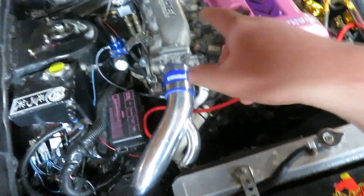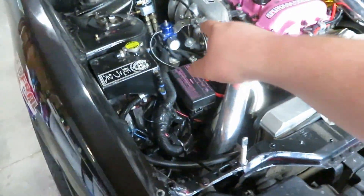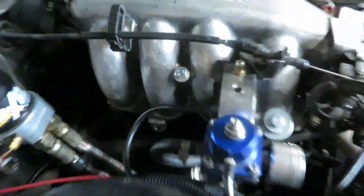Just so you guys know, when we put that bolt in here, that did help a whole lot. Now on initial startup at high idle I'm actually running about 23-24 pounds of vacuum, and at low idle I run 20-21. That is right on the money and I am super happy about it.